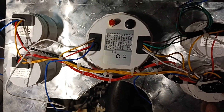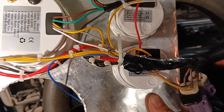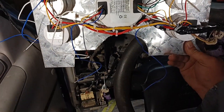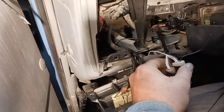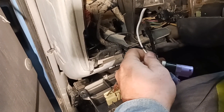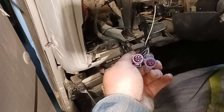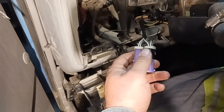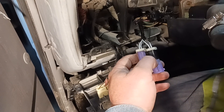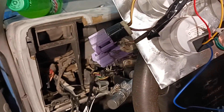All the blue wires and the white wires are the only ones still out. I've got this kind of tidied up over into the corner where it's right by the other two plugs. Down here are my two plugs — all taped in nice. I got two extra wires I might use for something later, so I've got those hanging out until I get done, then I'll tape them into the harness so I know where they are. These are my two plugs I wired in. I wanted different colors since they're the same on one end, so the one with black tape matches the one on my dash with black tape, and the one without black tape goes to the other.